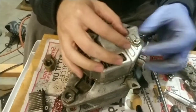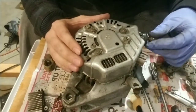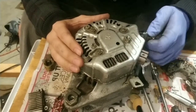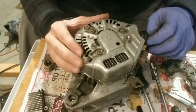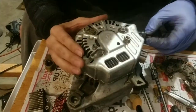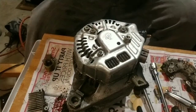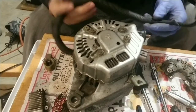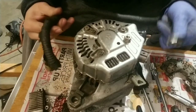The flat one goes here, and the high one goes over the wire — the wire to the battery. Tomorrow we're going to open the harness and take out that molten, rusty blue alternator wire to the battery and replace it with a new one. Originally my quick fix was to just cut the tip of the wire and replace it with a generic one, so this is a spare tip.